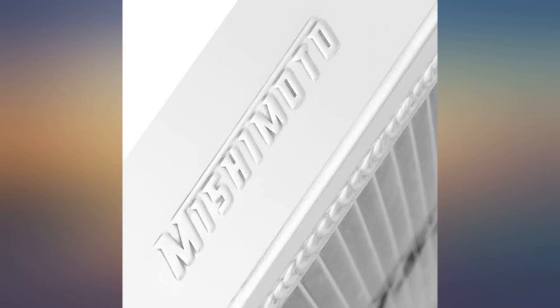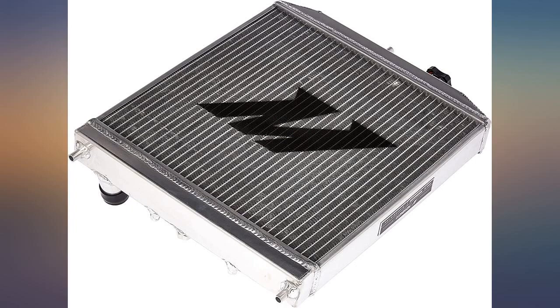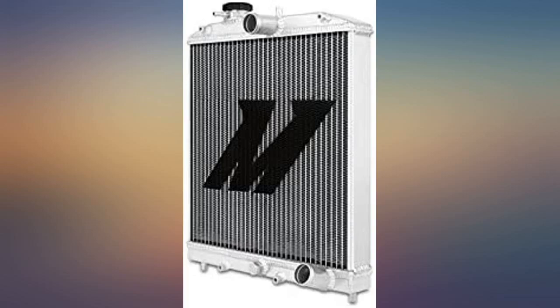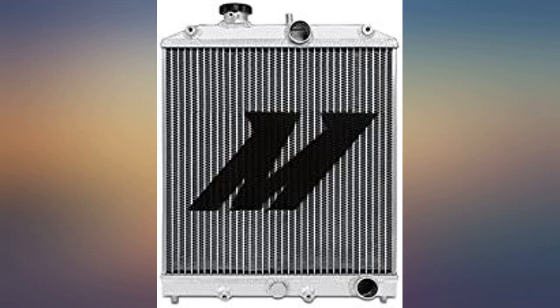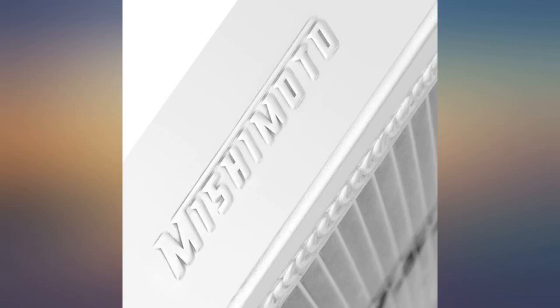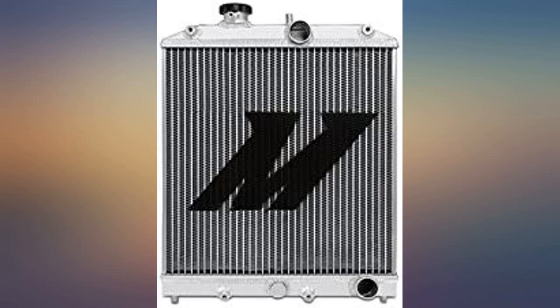Radiator itself is good. Radiator cap is crap. It causes overheating issues when in high boost. I did read a lot about the radiator cap giving trouble, but I was hoping that they did something about it. I put my old radiator cap back on and no more overheating issue at 25 lb of boost. The radiator itself is great.